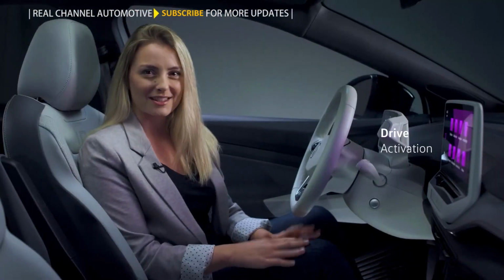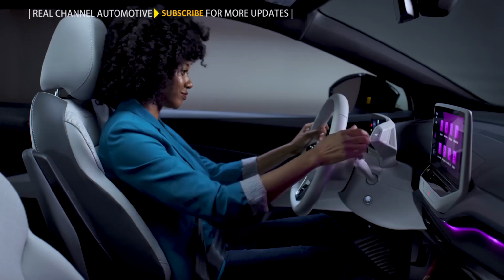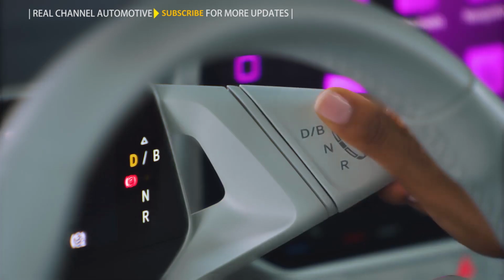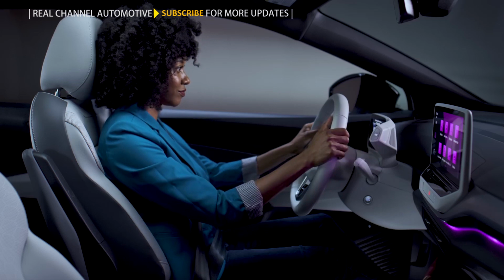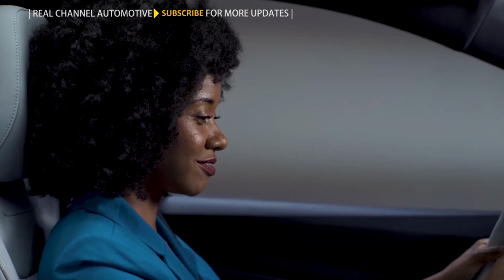To engage the drive system, fasten the safety belt and press the brake pedal. Then turn the selector knob to Drive, Reverse, or B mode for brake regeneration. A visual and audible signal indicate the drive system is ready.